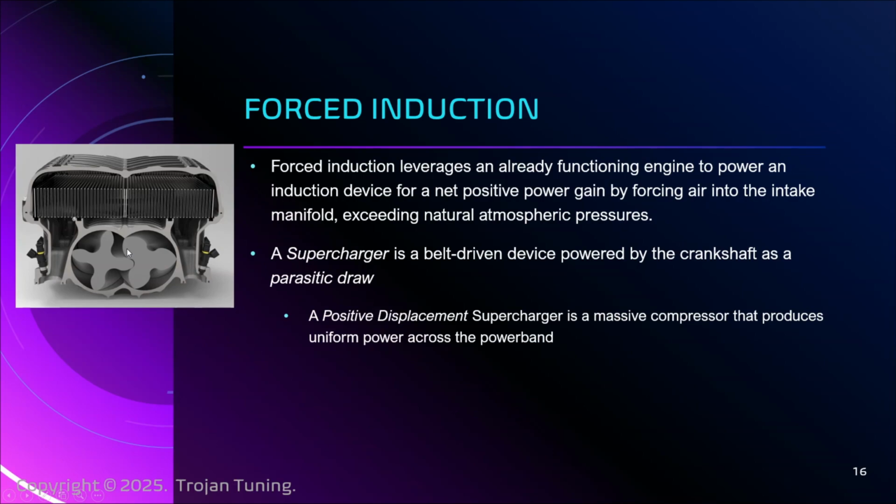They are compressing air. Now, remember what I just said. We just talked at great length. What happens when you compress air? It heats up. That's why the air has to move through this. It looks like a radiator. Radiators emit heat, right? So I take this hot air, I cram it through this radiator, which is called an intercooler, and the heat drives off into the atmosphere, right? Floods my engine bay. But the air will then come down into the runners of the intake manifold, right? And this basically, you take your intake manifold off and you put the supercharger on, and it has runners, and the air goes into the cylinder, except instead of it being drawn through naturally like a straw or a snorkel, we are blowing air in with this pump, right?